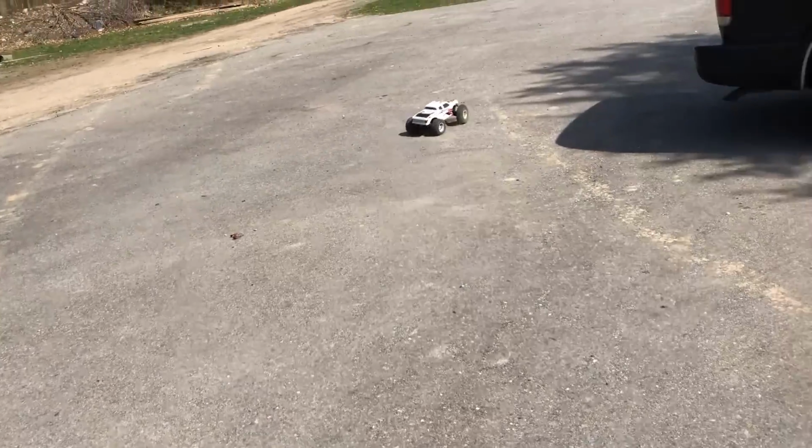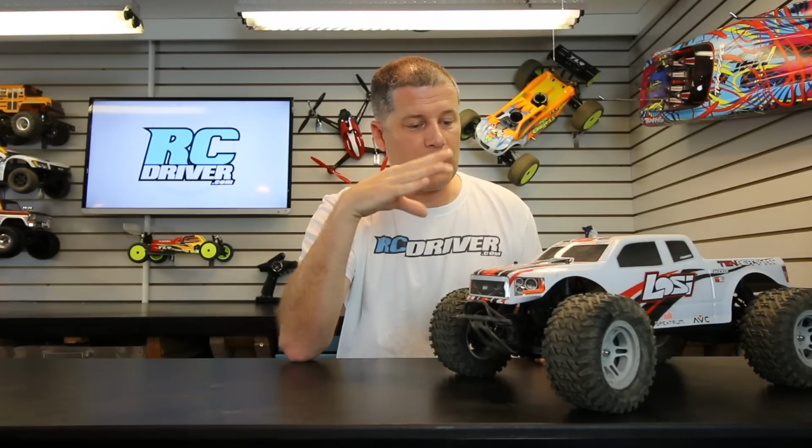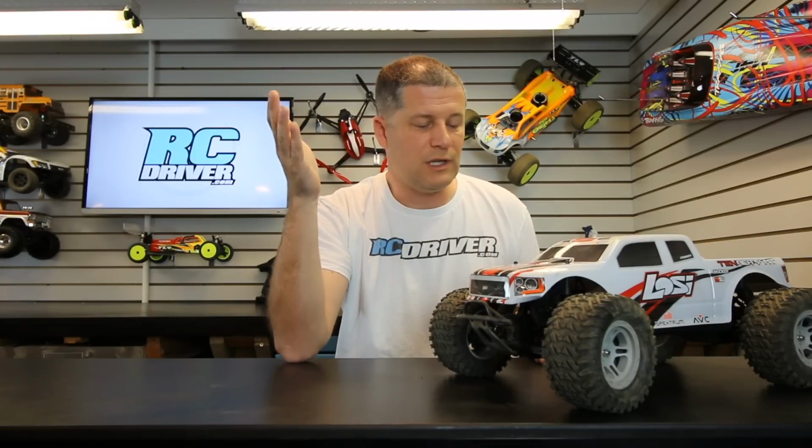Now, there's one thing that I wanted to address, or actually 2 things that I wanted to address with you guys, and I talked about it before, was the internal gears of the differentials. I set out to see if I could get the gears to skip on this like it happened on the truggy, and I only heard 1 click when I was driving full throttle on asphalt during the speed runs. At full throttle, I hit the brakes and I heard a click.